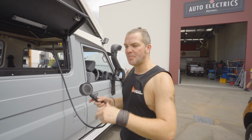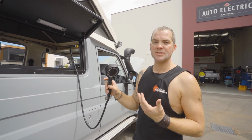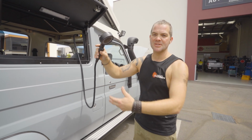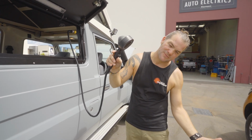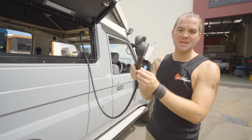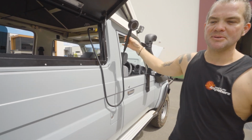All you do is turn the pump on, it builds up pressure, then your system will be pressurized, and as soon as you want to use water, you just open the valve, the pump turns on because the pressure switch realizes that the pressure has dropped because water is flowing out. You can have a shower, you stop again, the pump builds up pressure, burp, and then stops, and you can just leave the shower here for the time period that you camp.